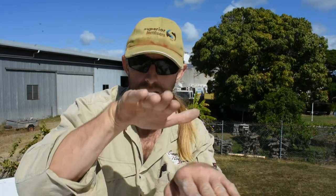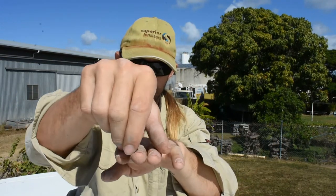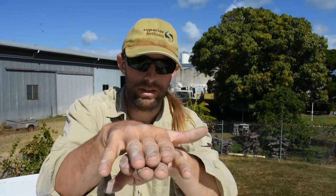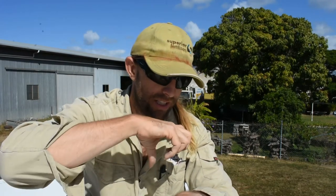Here we are at the rear of the bus — this is where our main water leaks are. The main problem is the rear on the passenger side. As far as I can tell, because the roof is solid aluminium, water shouldn't be able to penetrate through that. So my working theory is that it's creeping between the seams — one sheet like this, one sheet like that, they've been riveted down with a layer of waterproofing between them. Maybe over time that's corroded or failed. So what I'm going to do today is power wash the whole thing and then put another coat of waterproofing membrane over the whole seam.